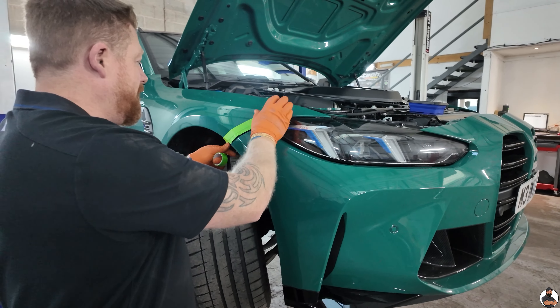Step eight — removing the front bumper. You pulled it away? Yeah. Beautiful! There's my screw I dropped earlier. Excellent. And there it is, guys — in eight simple steps the bumper is off. Now the bumper has two little lugs on the bottom. Same again on the opposite side just here. They hook over a metal guard on the actual frame of the car, which makes it a little bit difficult to pull off — so don't be shy when you're giving it a tug.